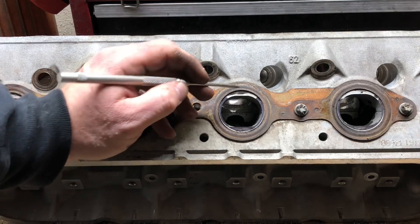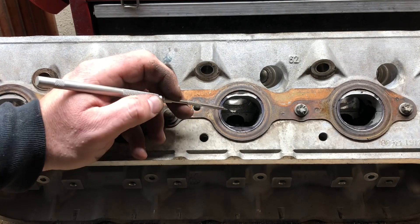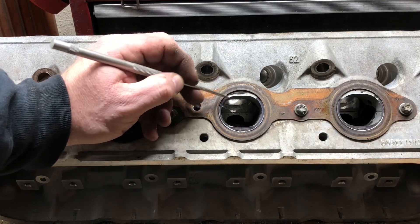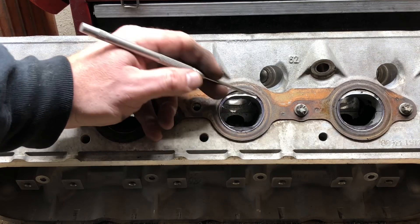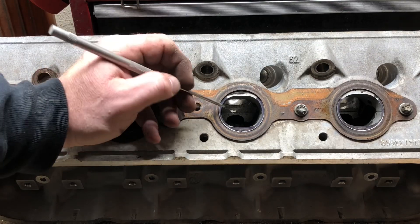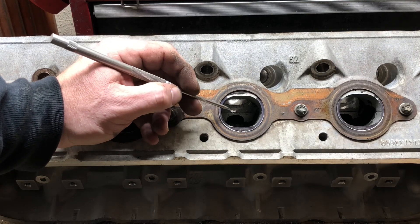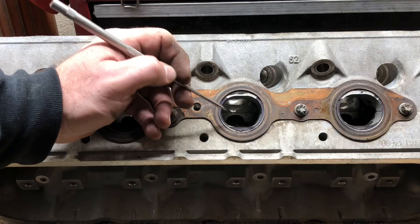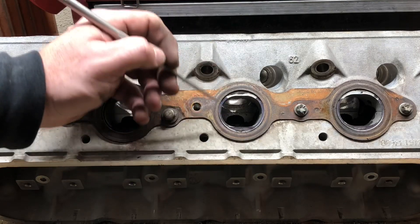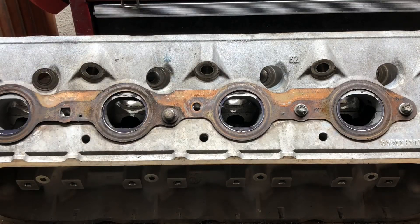Keep in mind: when exhaust gases leave the cylinder they are superheated gas that naturally wants to follow the highest part of the port - the roof - and get out of there at a super fast rate. It gets split by your valve guide boss, which will be greatly reduced in profile, then follows the roof to exit. You gain a significant bump in exhaust flow from your valve guide work and raising the roof, giving a less restrictive turn and a more efficient path for higher CFM. If someone makes that hole really super big, they are actually causing a detriment to flow - if the hole is bigger than your exhaust manifold or header you've created turbulence problems unless you're running custom headers with matching two-inch primaries.